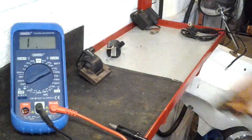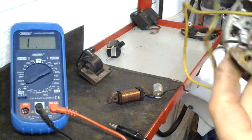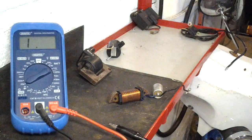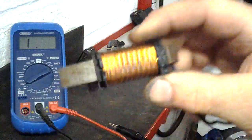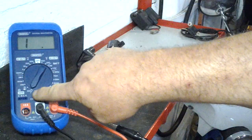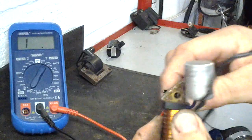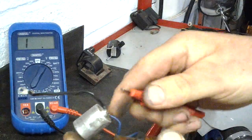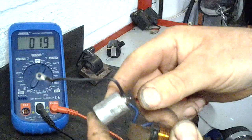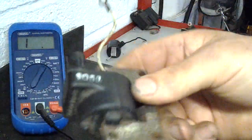There is almost an identical coil that fits in that position. The one with the yellow lead is for your lights — don't test that one unless you've got a problem with your lights. As this source coil is just generating power for the external coil, there's only one winding on it. Set to the low 200-ohm scale — it reads 9.2 ohms, so that one is okay and should be generating power to reach the external coil.